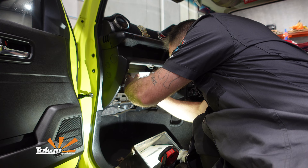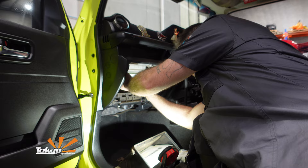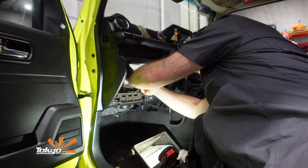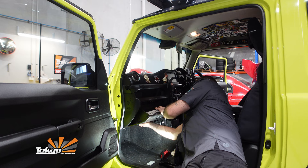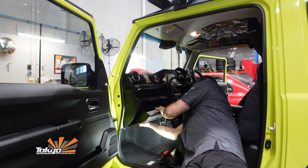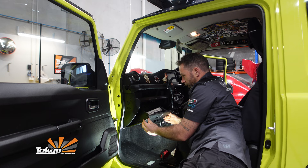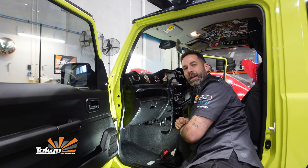Putting the cabin filter in now — it slots back into the housing. Just remember to pay attention to the airflow direction. I've wiped down the cover of the housing as well. Tony's is pretty filthy with the red dust from his adventures. Just like that, it's all back together. With the cabin filter now in, all that's left is to put the glove box back in. Just slot the two tabs in, pull it up nice and high, find the sections where the rear tabs locate back into the dash panel, then two firm pushes and she's done.